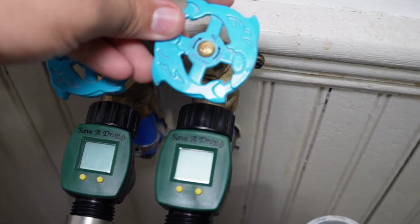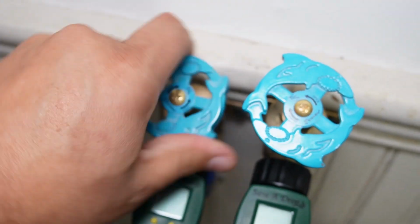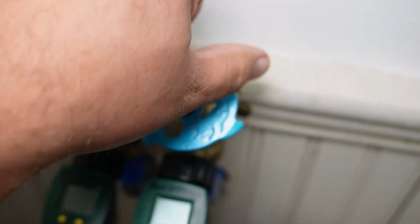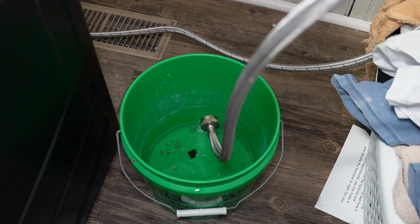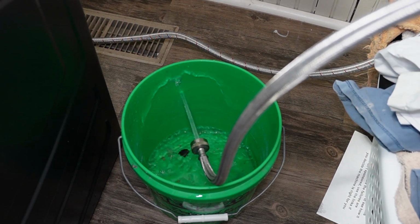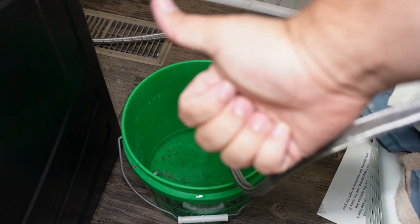First, make sure that your water supply is actually on. Is it possible that someone may have accidentally turned it off? Next, another thing to check is to turn the supply off. Unscrew the hoses from the rear of the washing machine and test the water supply into a bucket, and make sure that you're getting good flow into the bucket, both hot and cold water, as the machine may not run properly if only one side is working.